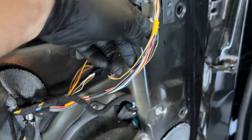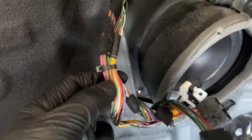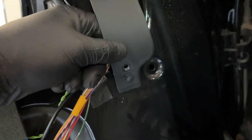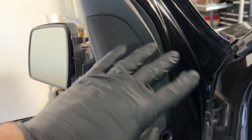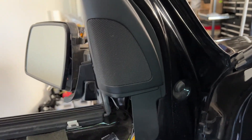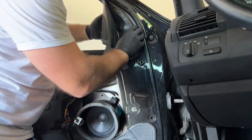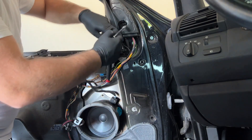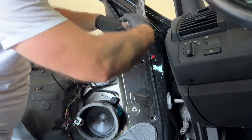The top panel is off. You can see this is your cable — it comes down here and makes a turn. Cut these two cable ties here. Remove this plug and take it out. Be careful with this connector as it's already forming — be careful with this one. Then we can access the tweeter and some insulation foam here. There are three screws to take the mirror off, which are T30.